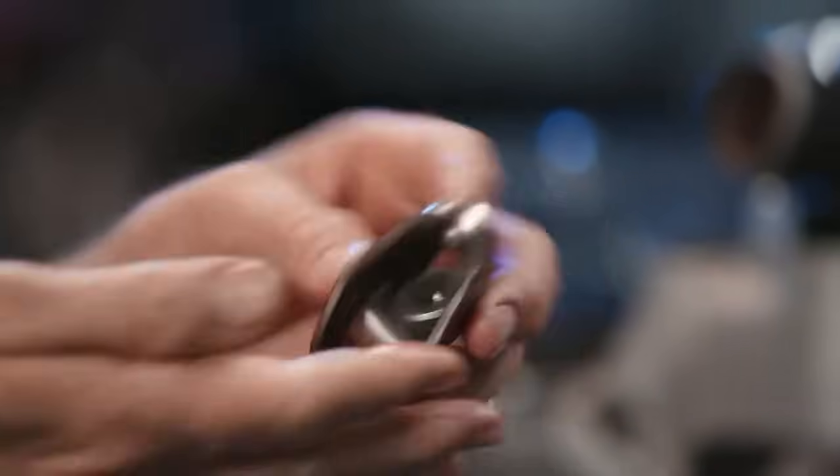There's nothing unique about these rockers other than being beefed up a little. The OD of the ball is the same size regardless of the ID of the hole for the stud. The center hole is bigger and the rocker has a wider slot. So it may well have the cup and ball of a big block with the ratio and length of a small block — it's kind of a cool rocker. They sell this in a 1.6 ratio too, even though we've got 1.5s on it now. The long slot is also a consideration if you've got a lot of lift, because you have to make sure it doesn't bind up — or that could be catastrophic.